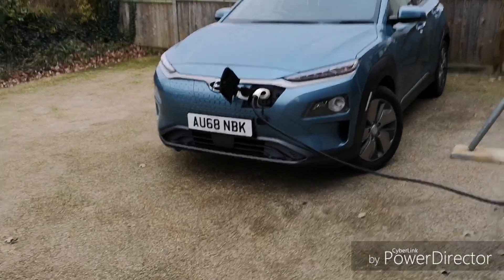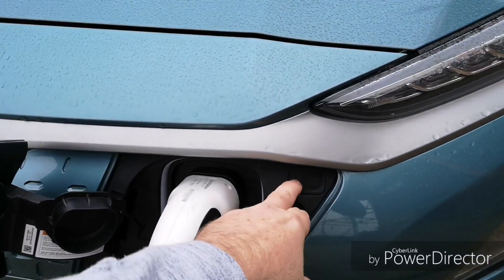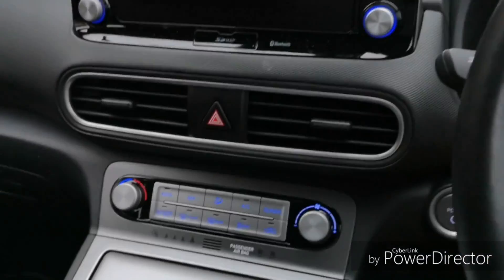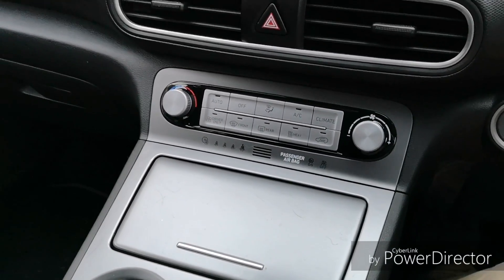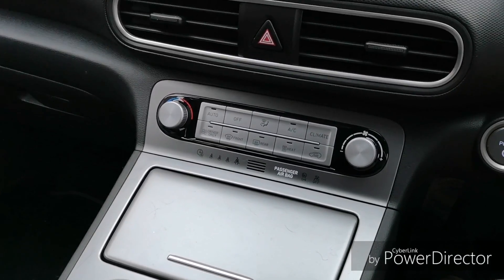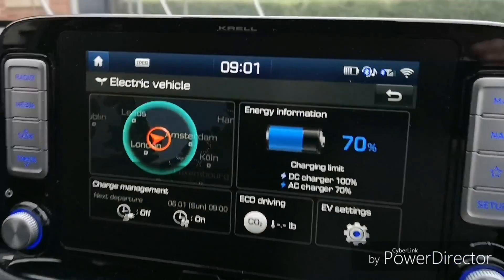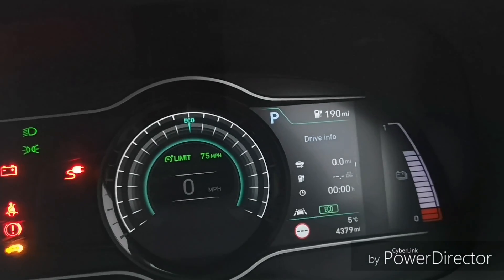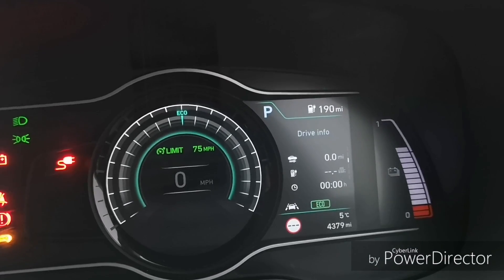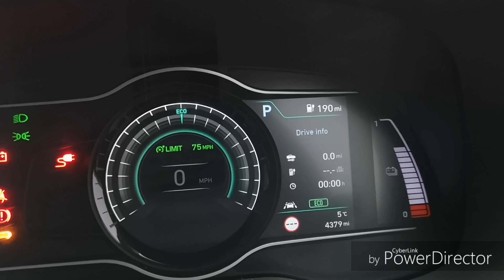It's nine o'clock - let's see what's happening. No yellow light on the front, no amber preconditioning light, and no charging - it's stopped. Inside the car there's no preconditioning on, no heaters on, and it is lovely and warm - feels about 21 degrees. Job done. When the car reached departure time it switched off. The range still says 70% and 190 miles - it looks like a minuscule amount of energy went in to keep it at 70% state of charge, but effectively the range is unchanged.